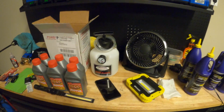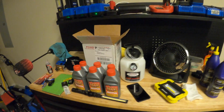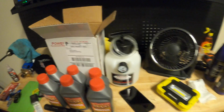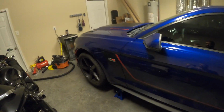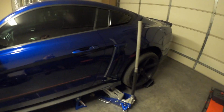And this is gonna allow us to pressurize this pump. I think it's either 15 or 20. I have to look up what you're supposed to do on these. But anyway, we're gonna get some pressure in it, and it is a vacuum seal. So that'll allow us to actually remove the wheels and just go around and crack the bleeders, and because it's vacuum sealed and pressurized, it'll just pump fluid through continuously until we close the bleeder. So one-man job, makes it a lot easier, obviously.